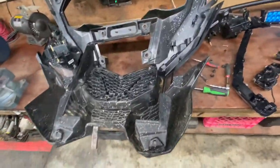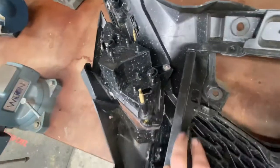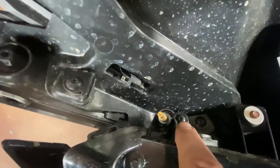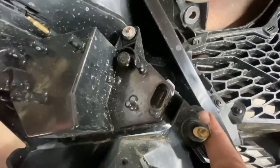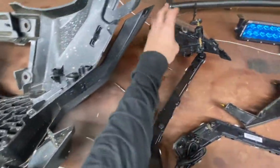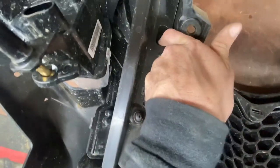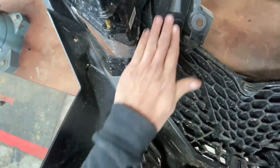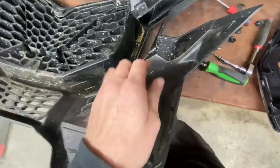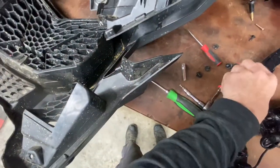Once you get the nose off, get it up on a workbench - you have to do some taking apart on each side. Your headlight bolt is a 7mm, take that off. Down in there that little T20 is the same size as the one holding this one, so you take those two out plus the 7mm and the headlight comes off. Then you've got a couple of T30s here, and another little T20 that takes the little plastic guard off. Then you have one more T20 holding right here - it's usually covered by that guard - and you can get your accent light out.